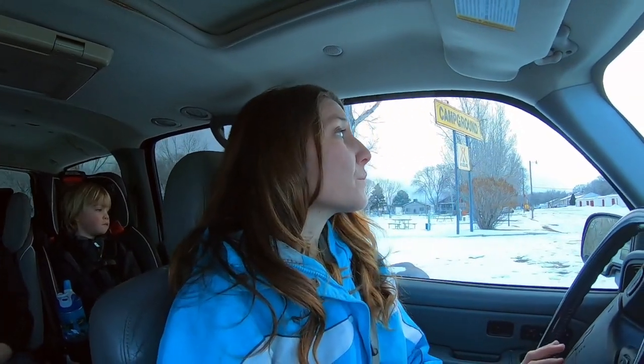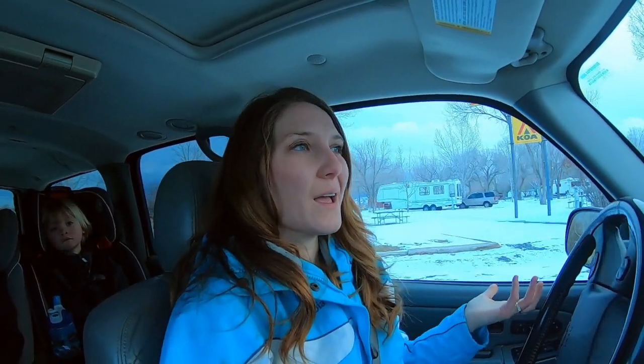Something that you notice while we're backing — and I'm not sure how it is for you guys — but there is zero play in a trailer of this size and this weight. Every other trailer we've had, as far as hitching up, there's been some room for error — we don't have to be exact. This trailer, the ball — we use the Reese Goose box and we use the turnover ball — the ball has to be exactly under the trailer. I would guess it's just because it's so heavy, but I would love to hear your experience. We've always been able to wiggle them a little bit — a bumper pull, our other fifth wheel, any other trailers we've pulled — and we've pulled a lot of trailers. This one is exact and it's really frustrating to have to back up multiple times to get lined up right.